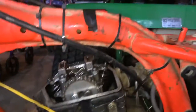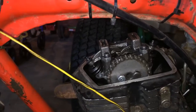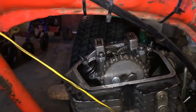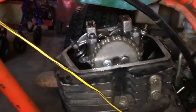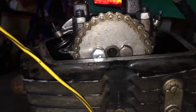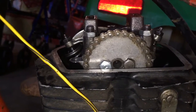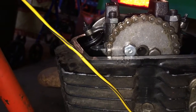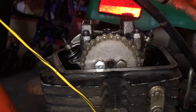All right, we're back. The two bolts have been loosened, the cam gear sprocket slid right off the cam. I was able to drop it down just a hair to get the chain loose enough to rotate it forward one tooth. You'll notice it's now at top dead center — there's the mark right there; I scratched it with the screwdriver so I'd know it. Anyway, you'll notice now that it is at the horizon of the top of the cylinder head. Previously it was a little late; now it's right on time. It's got good spark, good compression — I'm guessing she should fire right up.